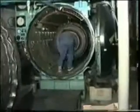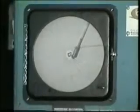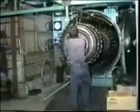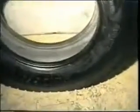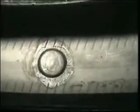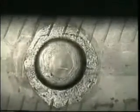The tire is put in the vulcanizer for heat treatment. At the end of the curing time, determined by the tire size and other factors, the tire is taken out of the vulcanizer and subjected to careful final inspection. Let's see what happened with the GUT patch. The vulcanized patch is tightly cemented to the tire as shown, allowing for the manufacture of high-quality retreaded tires.